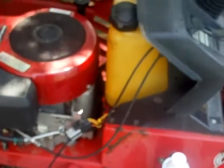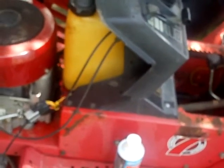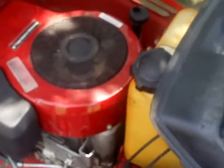I'm thinking I'm gonna pull this one first. I haven't fully decided. I'll do the crank pulley first, get that out. Hopefully it's not seized. Shouldn't be. But if they won't drop out, what I'll do is I'll just unbolt the engine, just lift the engine right up over top of it. That normally will pull them out. So when you've done enough of them, you figure out some tricks. So yeah, I'm gonna get ready to pull this.